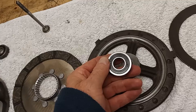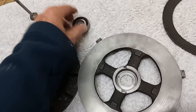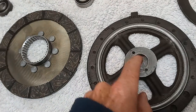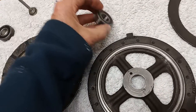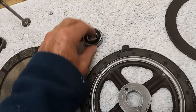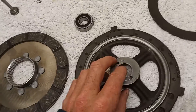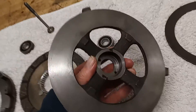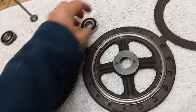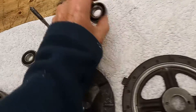For that reason I've drilled two holes in the cover plate. When this bearing goes in it fits in here and goes that way up. The problem is if you ever want to take that bearing out - on a normal bearing you can see the inner race and knock it out, but on an uprated angled bearing, knocking the inner race will simply remove it leaving the outer race firmly in the pressure plate with no way to extract it. So if you upgrade, drill two holes so you can get a drift in and knock the bearing out from the inside.